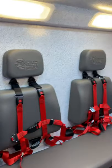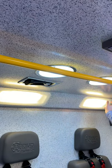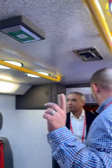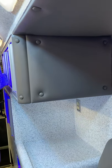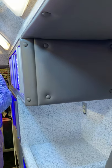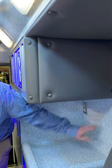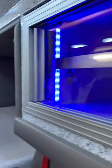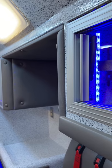Our roof ribs and hat section roof ribs come across — we fully weld every rib, and then between every rib we put about a four to five inch weld. On top of that we put the roof down and full seam weld it from front to back, and we full seam weld the rear header as well. Then we spray foam insulation — we don't use plank foam because we don't want it to sag. Six years later if you sell the vehicle, it's never going to sag or cause heat and air conditioning problems. The spray foam hardens and once it dries, we push this assembly in on top and weld it all together, creating a solid body with everything fully welded.